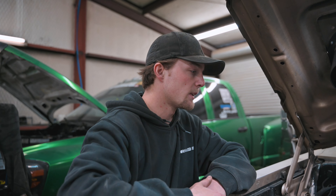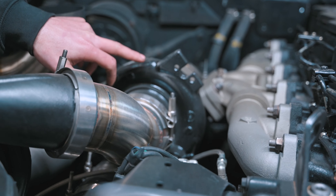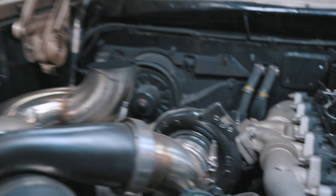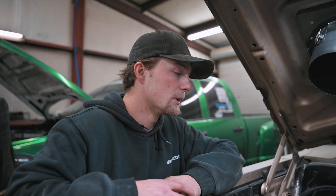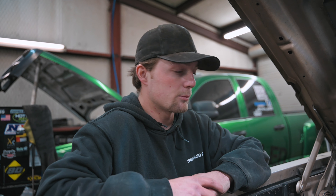So what size are the injectors and what size are the turbos? It's got Flux 5x13s. They're not super big into the mechanical world — they normally stick to the common rail side of things and they do a lot of Duramax stuff too. So Flux 5x13s. This is a HE351 that I built with a billet wheel that was on the truck about two years ago, and I had a hood stack with no hood and drove that for a while until I could build a downpipe. Chris gave it to me — it was just in a box of broken HE351s, I just pieced something together.